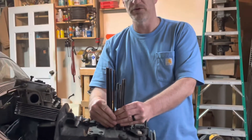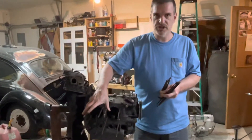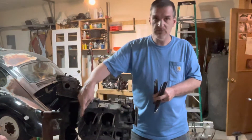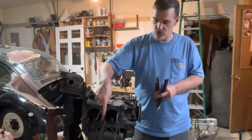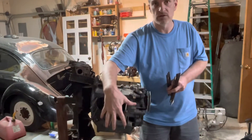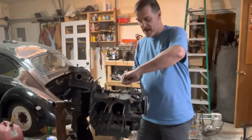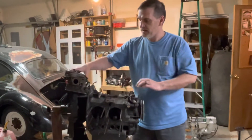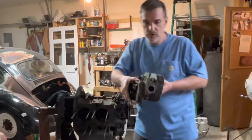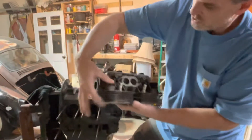There's a reason for four different ones. On the top right here, where your jugs or cylinders go in, you have a medium one, a short one, a short one, and a medium one. Then all four long studs go into the bottom. The reason for this is because when you get ready to slide this head on to your cylinders, there's a different thickness here.